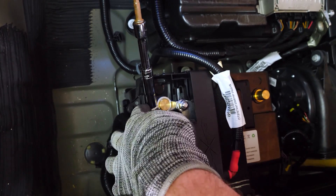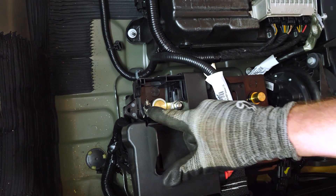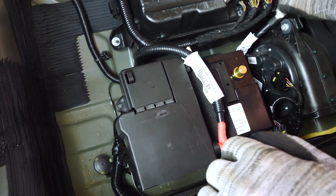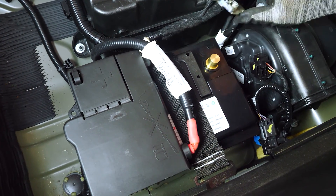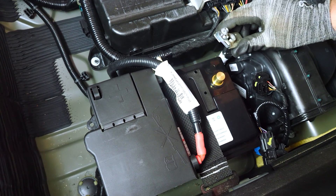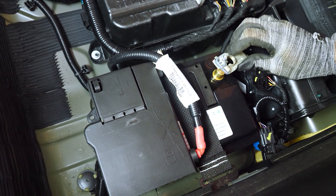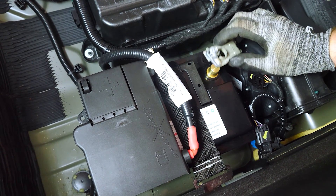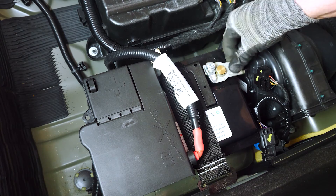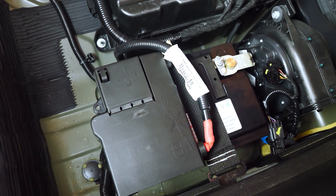Using a power tool on these lugs — if you don't use a power tool all the time — is probably not the best idea because you might over-tighten or strip it. It's a good idea to switch to just a typical standard wrench unless you're really comfortable with the power tool torque. Then on the other side, we're going to make the negative connection — we do that second always, because we'd rather have a negative wire hanging around than a positive. When you make this connection, there's going to be a decent amount of current rushing out to power up all the various modules. So just line it up and push it on quick and you won't see any sparks or arcs. Then tighten that down until it's nice and snug.